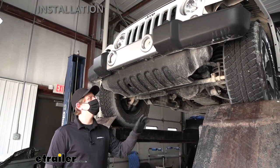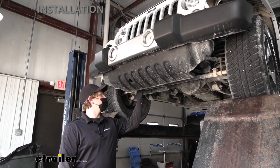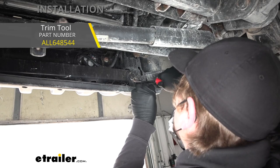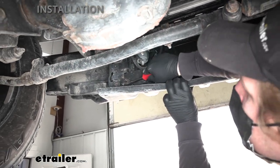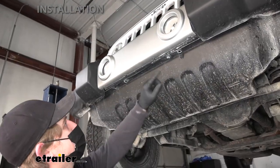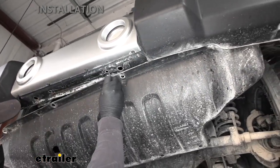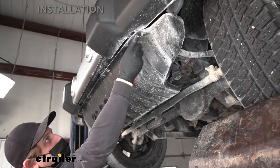To begin our installation, we're going to be at the front of our Jeep and we need to remove this plastic panel. There are going to be a total of six fasteners — four on the front and two in the back. We'll start with the two on the back side. If you look behind it, you can see one of the fasteners on each side. Take a trim tool or even a flathead screwdriver, simply pry underneath the head, and work the whole fastener out. Up front we have those four push pins set up the same way, so get those popped out. Once the last one is off, the panel should come down — lower it and set it off to the side.